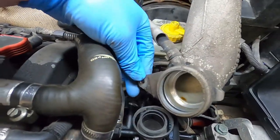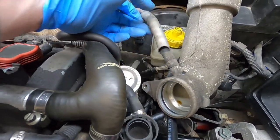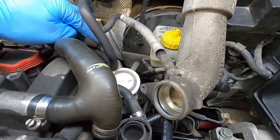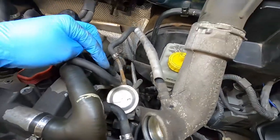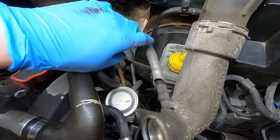Here's just an additional angle of where that bolt is on the inlet pipe. The last thing you have to do is remove this vacuum line — I still have it, I have nothing deleted or rerouted on my car. Yours might be different, but if it's bone stock, you've got to remove this, and then you can take the turbo inlet pipe completely off the car.